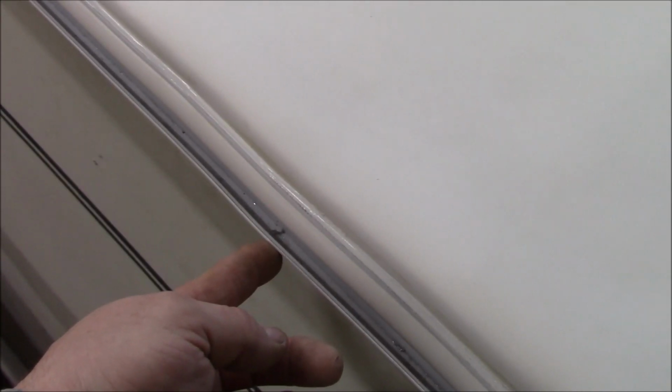And then there's 2 strikes of caulking all over this, and there's also a primer on there. So the way these get assembled is behind this gutter rail, we seal that. We have an adhesive caulk that we use, but you have to use a primer. You can barely see it right there, that gold. So you have to use a primer. We put the primer on there, then we put the piece on and we fasten it on there with some screws. It's going to burp up. When it does, we strike it down. Once that gets struck down and cures, we come back and we put another lick on there of caulking. When that cures, we go back and put yet another lick on it. So we want to make sure that it's tight.